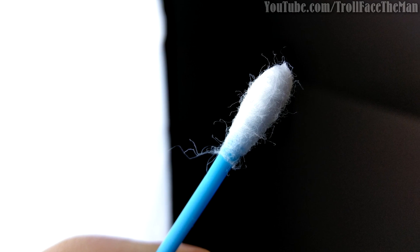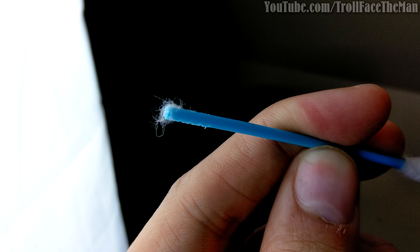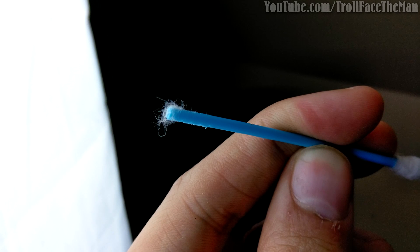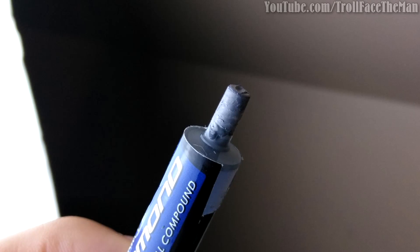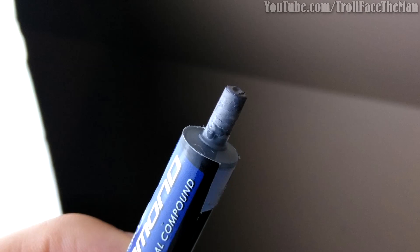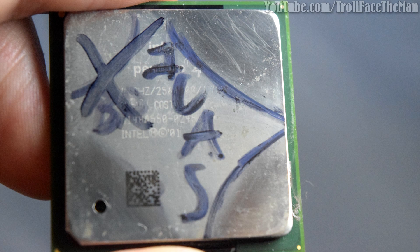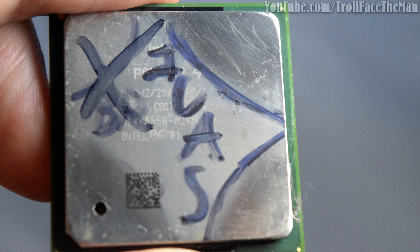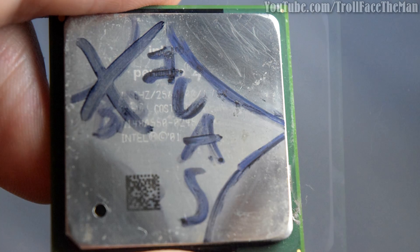The scratches were in an area where I dragged the tip of the thermal paste applicator across multiple times while trying to smear it. And while testing with the Q-tip, the cotton fell off and I dragged the bare plastic stem across a few times before realizing. I'm not saying the plastic scratched it — what I believe happened is the diamond stuck to the edges of the plastic and basically made a diamond-tipped cutting edge that allowed the humble plastic to do significant damage. If this is true, I should be able to remove that variable by simply using a cloth instead.